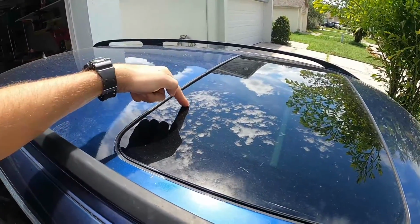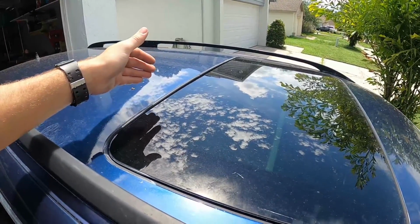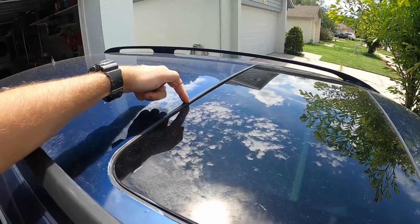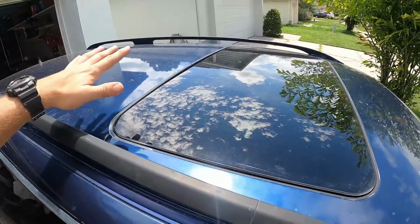And again, if the sunroof doesn't have perfect alignment, and let's say when you put it to the front position, it doesn't match the stopper and it's not to spec, then you'll get a misalignment, which can cause water to leak in, even if the seal is brand new. So make sure that your sunroof cassette stays greased up and that the entire mechanism is working well.